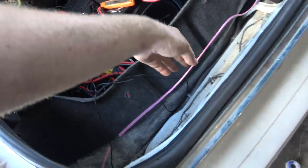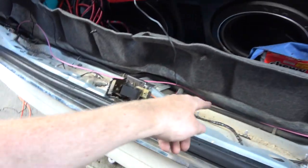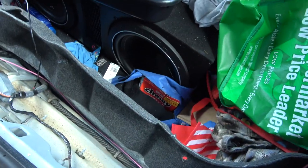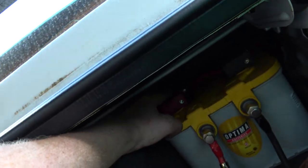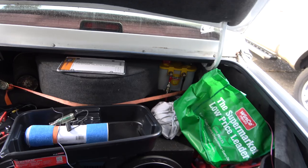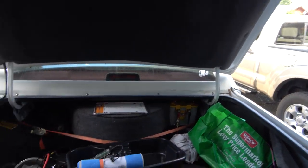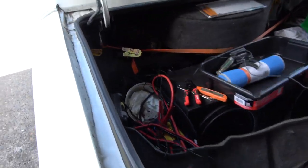That's a black with pink or violet wire. This one is going to hook into that red wire that goes to the auxiliary — that's power. I'm actually going to loom it inside this harness here, then it's going to come along behind the carpeting. I've got more loom to run it through so it's not rubbing on the body. It's going to come along, sneak over, and plug into my battery back here — or I'll put a ring terminal. That battery gets connected to the car when it's running, so it gets charged and we'll have power back here for the trailer.